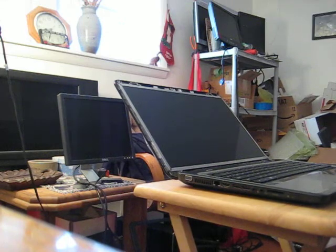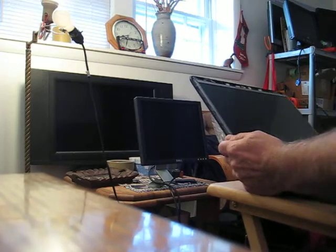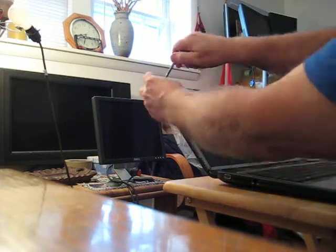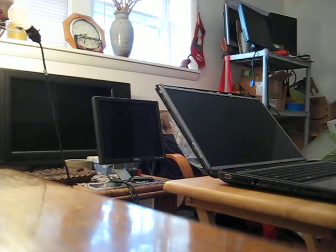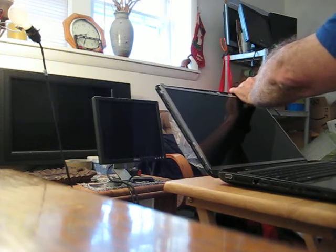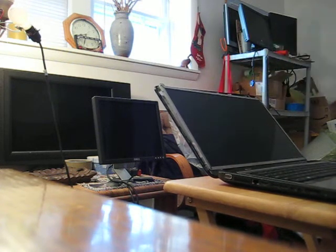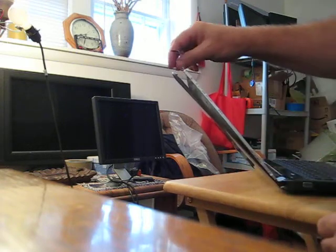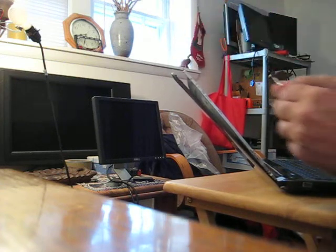Now we have the screen. There is a screw at the top, screws at the sides, and one at the bottom on each side — that's what we're going to be taking out. To begin with, we have to take the screw off the top completely. So far all the screws are the same size, so you don't have to worry about mixing them up. They're all covered, so you never see them when you're done. That gives us a little bit of play to work with.